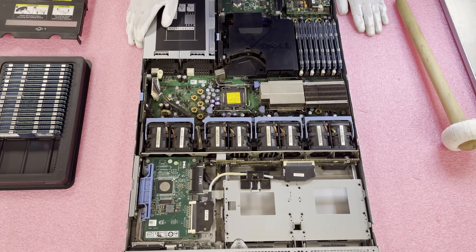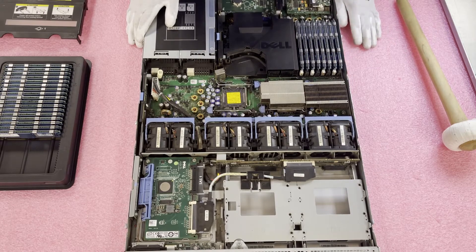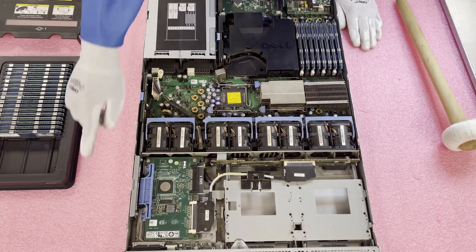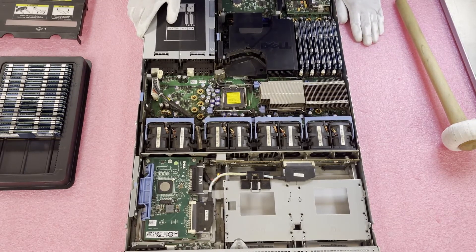One question we hear a lot: to use eight-gig modules you have to have a Gen 3 — you cannot use a Gen 1 or Gen 2. How do you find that out? If you look on the left ear of the machine, there will be Roman numerals — just straight lines going straight down. If there are three Roman numerals, you have a Gen 3. If it has two Roman numerals, unfortunately you have a Gen 2, and Gen 2 will not accept eight gigs. You'll be stuck with four-gig modules — that's the max for a Gen 1 or Gen 2.